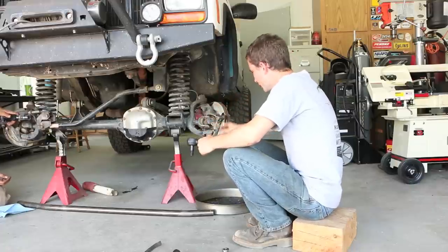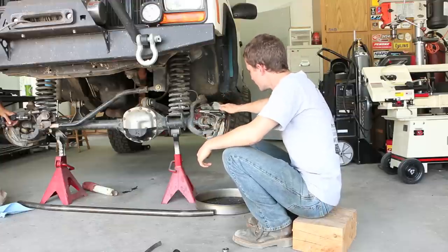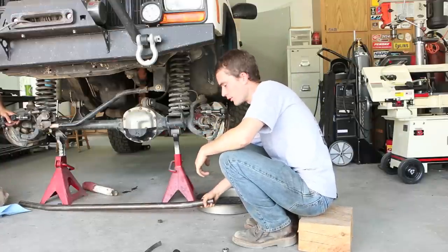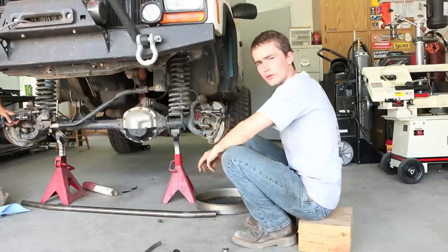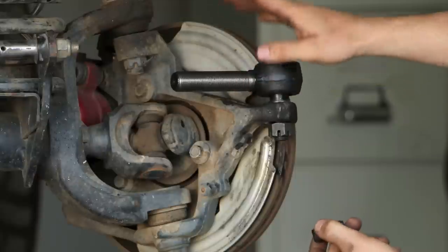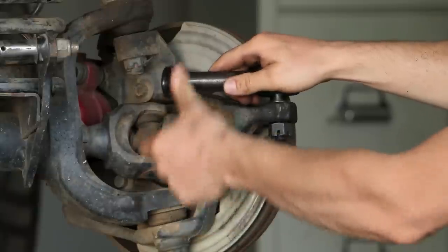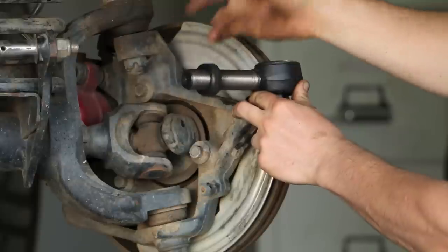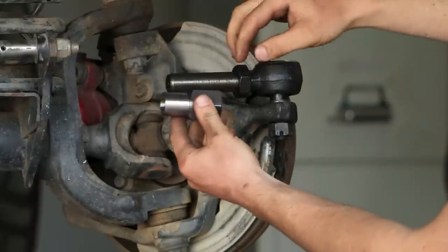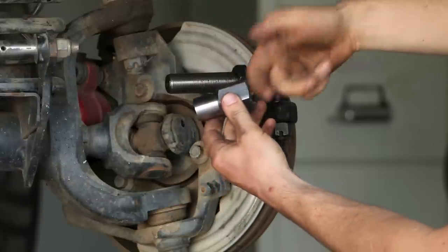Now that we have our knuckles bored out and sleeves inserted, we're going to get our tie rod ends inserted, locked in, and bolted down so we can start taking hard measurements for our tie rod — whatever needs to be cut to the proper width. Once you get your tie rod end in place, the first thing you put on is a jam nut. The driver side is a right-hand thread; the passenger side is a left-hand thread. Get this all the way down, just about as far as it will go. Then your weld-in bung will thread in — run this until you're about one inch from the meat of your tie rod end.